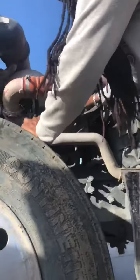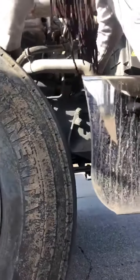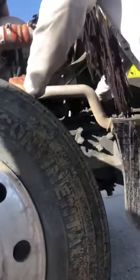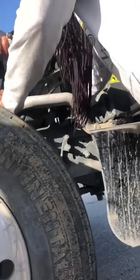Then I drop down to my water pump, which is also belt driven. It's properly mounted secure, it's not leaking, and my belt should have no more than 3/4 inch of play in it, and it's not frayed.